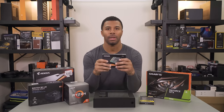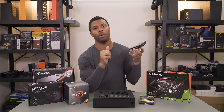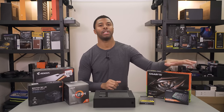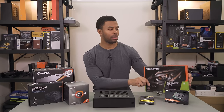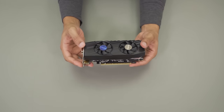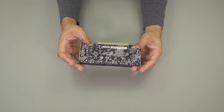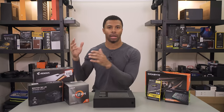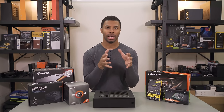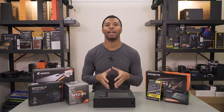For storage, I'm not going to go with NVMe to keep the cost down. I have a 1TB Samsung 860 EVO which should hold games and give you typical SSD SATA speeds — fine for this system. And lastly, the GPU, the star of the show, will be the low profile GTX 1650. You should be able to handle 1080p gaming across pretty much anything at 60 frames for most games, especially eSports titles. High-end AAA titles might not run as well, but for eSports or first-person shooter gamers, most games should run just fine.